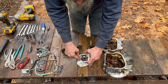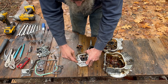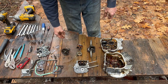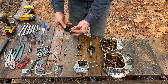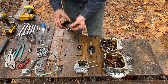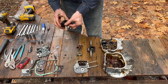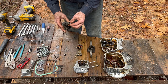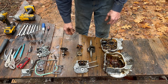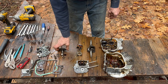There's quite a bit of schmoo down in the head — I think that's blow-by from around the valve guides. The cam is pretty good; there's some wear on the sides of the round part of the lobe, which seems weird to me — maybe that's just the ramp, where it hits first. Cam guys are probably laughing at me right now, but that's what it is. I wouldn't really have a problem putting that back in a motor.